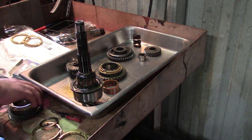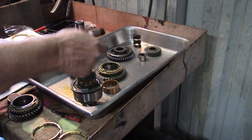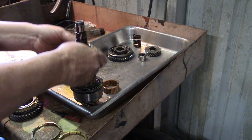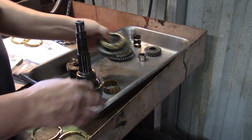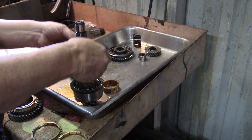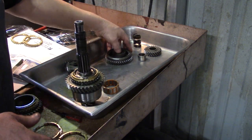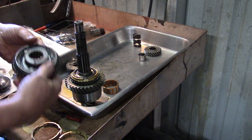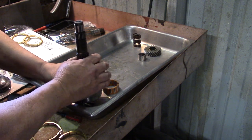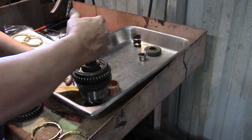Alright, we're going to assemble this pinion shaft, going through the synchronizers. My synchronizer ring for second gear is a little bit different — I don't know how I feel about that, but I guess we'll go ahead and try it. Put the shim on the pinion shaft first — there's a shim that slides over the pinion. Got some gear lube on here. Lube this up. First gear is first. Next will be the slider assembly. The boss goes up. This is splined on this shaft; on the other shaft it's going to be heated and put on that way.